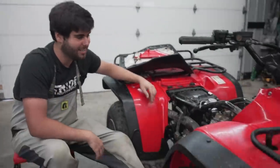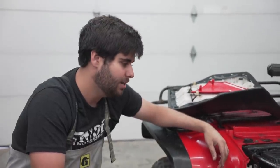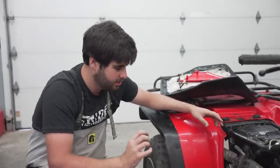Well, guys, I hope you enjoyed today's video. We sunk the 300. Kendall, we sunk your foiler, buddy. It didn't take long. The whole snorkel system's watertight. All the vent lines are watertight. They're perfect. Every vent line's ran. Something's funky with the carb. It's getting water in through this carb 100%.